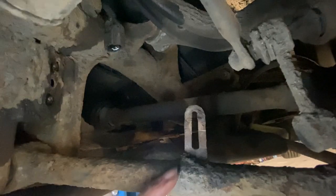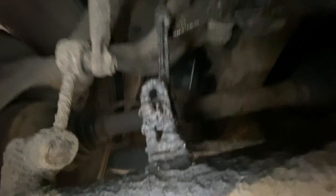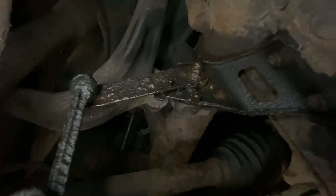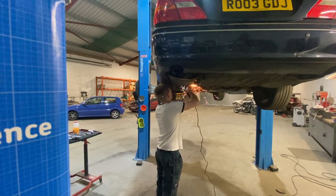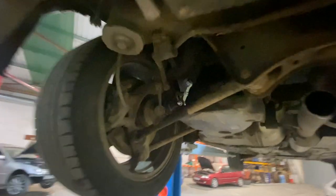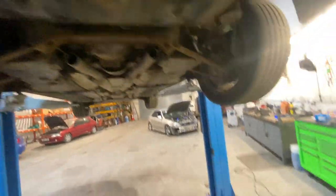With the rear it was actually easiest to take off the part of the linkage here, then take the two bolts off in the bracket and unbolt it, simply because the top of the linkage just doesn't come off at all. On this side I'm going to do the same — they're probably going to be cut off too. The top one I'll just take off these two bolts because I only need this bit off. It's just spinning so I'm going to cut this one off too. For the back ones, we just put a bit of threaded bar in and put the two links as short as they could, and it's only taken about an inch off. I've done the same with this one and buttoned it back up — it's sitting fine.